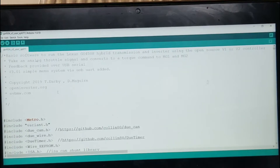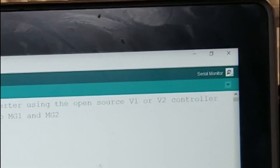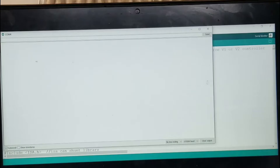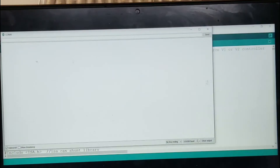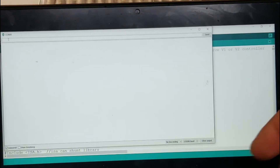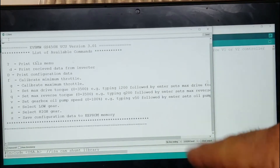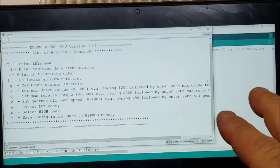How to check for serial communication: you go over here, there's a little magnifying glass — click on that and this window pops up. Then you make sure you're on 115,200 baud by selecting that down here. There are different selections. Make sure you're on that one, and then up in the input bar you type in the question mark, and this menu pops up.